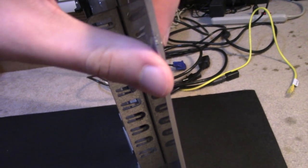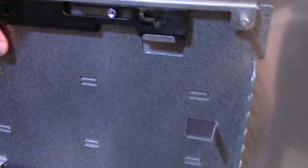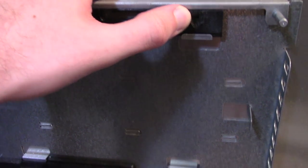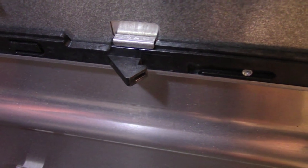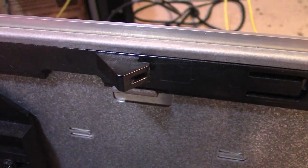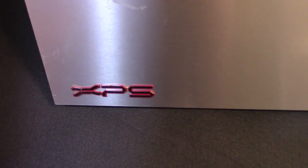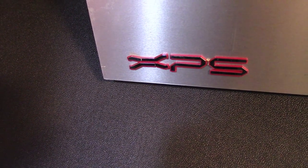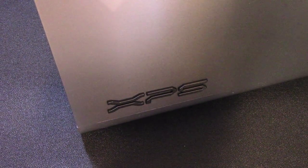As you can see, this has been gouged up and actually juts out as if someone put their fingers around the side panel and pulled it off. If you look here, you'll see there's some broken plastic — those spots were the plastic hooks that lock into places on the case. This rear handle pulls the whole system out, so this is how the side panel comes off, in a similar mechanism to the Power Mac G5, though not as smooth. It's a locking spring system, so I replaced this panel with a new one. Its XPS logo was getting worn down, bits of it breaking off, so it now has a brand new one — though technically black, I don't think it makes too much of a difference.